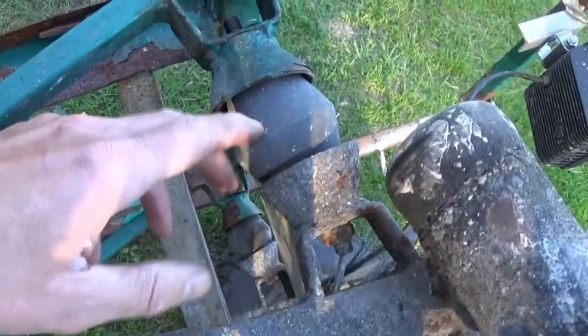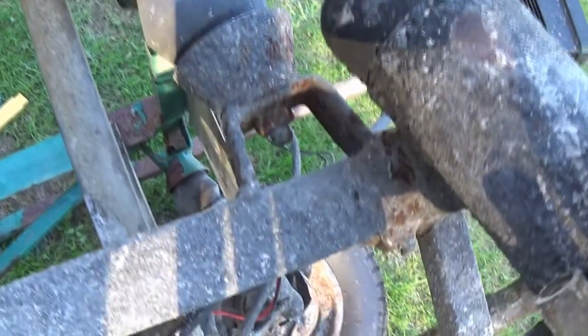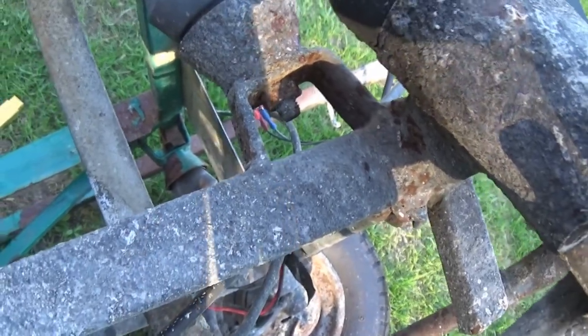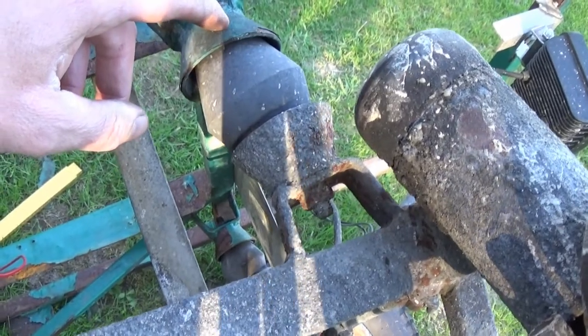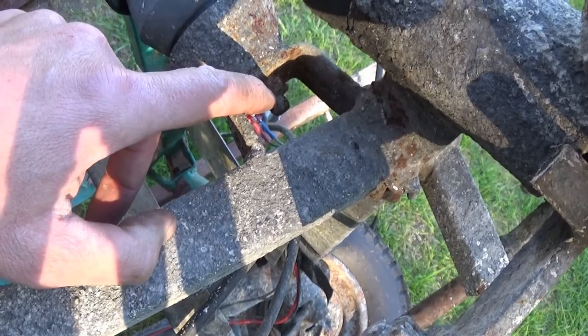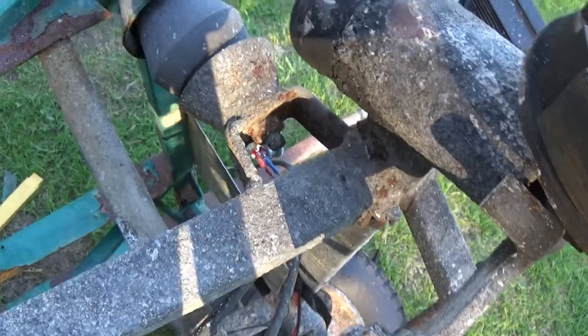It is bushing, which is a suspension. This is kicked over this way, and that's because someone's just tried to weld everything together. The whole thing is also not square, but that's not easy to fix. But I need to take some measurements. So I need to get a measurement straight down here. And that's going to tell me the distance from this point to the bottom of the suspension bushing. And then I can just make everything else square with that. I think. I hope. Yeah. That's a plan.